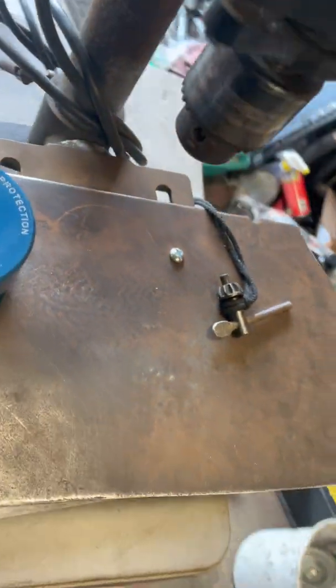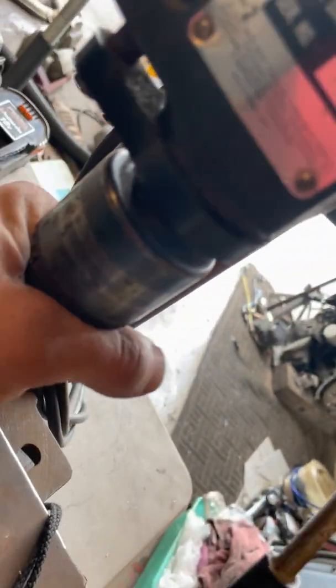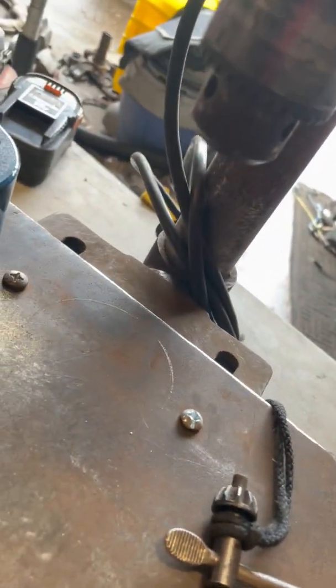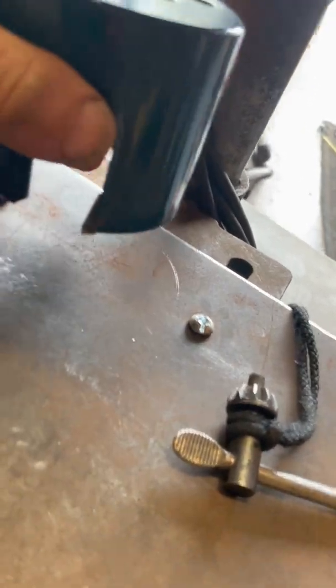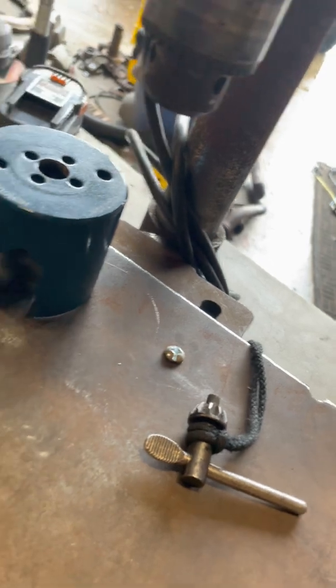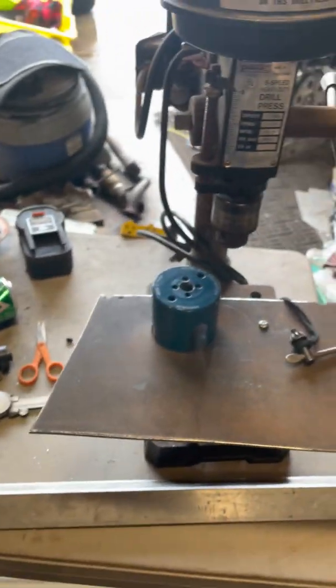And it's important, if you're going to do this, you make sure that your drill press, when it's all the way up, has a real tight bearing, no play, and you can't push it up at all. You know, zero observable play, because if you try to do this on a drill press that's not that way, when you push your work in between here and your table, it'll move up and you won't be able to keep your dimensions correct. So that's what I'm going to be working on here for you.